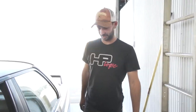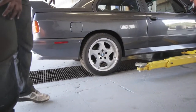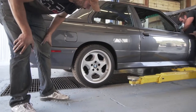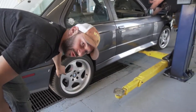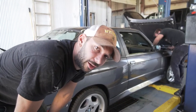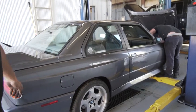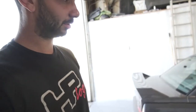Check out the wheels on this thing. These are style 21s, which are an M system. The 21 refers to the cover. The turbine covers are style 20. What makes this set cool is this is a staggered set. These are 9-inch rears, which on all the US cars, these came on E34 M5s, they only came with 8-inch all the way around. So we have Euro spec 9-inch rears and they fit on an E30 M3. So they're on there. I got new covers.